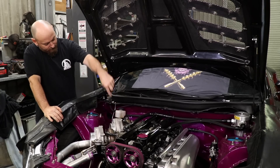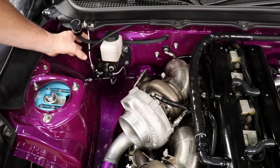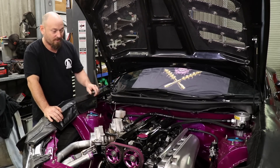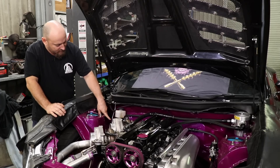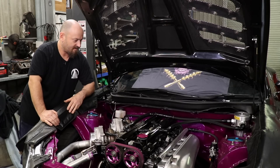Brakes-wise there's no booster — it's just a Chase Bays assembly that replaces the booster. It's actually designed for a left-hand-drive car but we adapted it to work with this one. It all bolted up, but all the lines supplied didn't work so we replaced them all with hard lines. It's also got a bias adjuster in there. There are a lot of little touches like that integrated into this car purely because we needed all the space we could get to house everything.